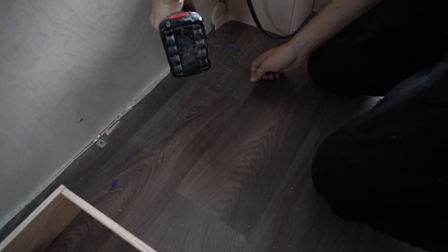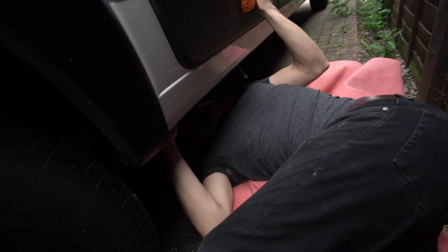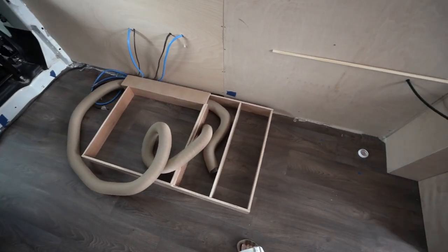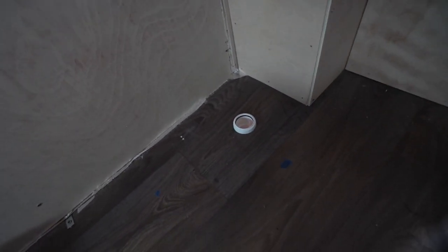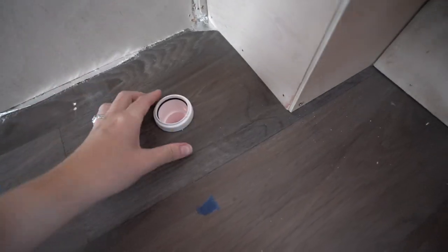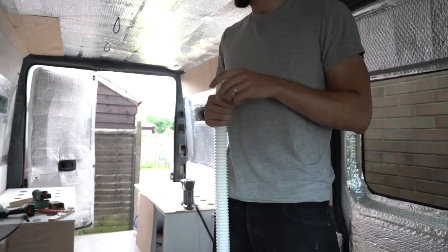The first pilot hole is being drilled — it's meant to be here somewhere. After a couple of pilot holes that didn't work, which you can see, we moved the position based on where the ribs were underneath. We used a 51mm hole saw and cut all the way through the bottom, then cut slots in the pipe. The fitting literally fits in there perfectly, and we're just going to stick a flex around there to glue it in.